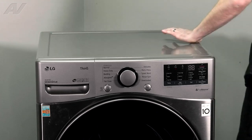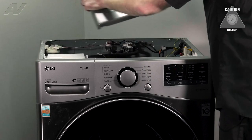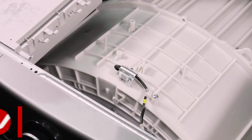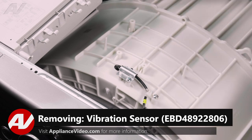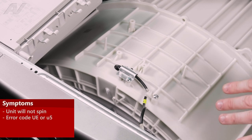Next, be very careful. Let's slide this sharp metal off, lift it up and set it to the side. Now that we have the top removed, we have clear access to the vibration sensor. The main reason why you'd be replacing your vibration sensor is that the unit will not go into any type of spin because it thinks it's off balance.